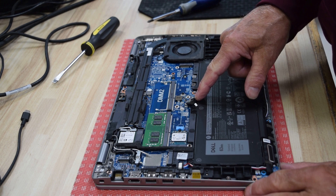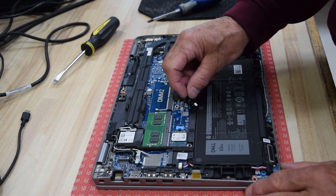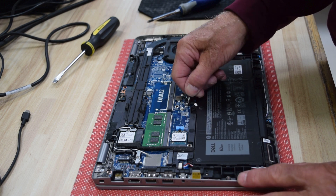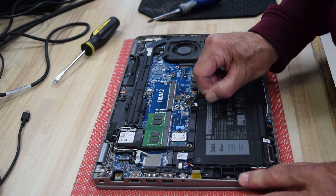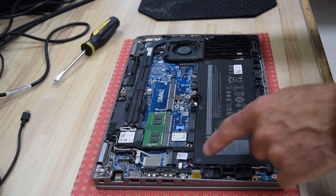There's a little cable that plugs to the motherboard. The first thing to do is unplug that cable — it's got a little handle on it. You grab that handle and pull straight up on it; it's just pressed on there. That disconnects the battery from the motherboard.